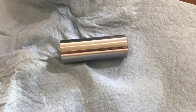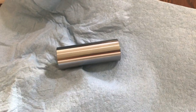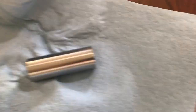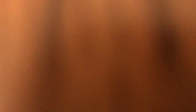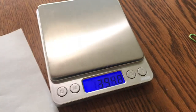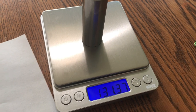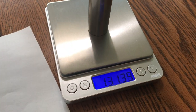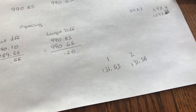Any little bit of grease or oil left on this is going to cause an unbalanced reading or a misreading, so you want to make sure to get every little bit of oil you can off it — that means even on the inside. Now that it's all clean, we'll take it over to the scale. Put it in the center. 131.37 — 39 — 37. So we're going to say 131.37. We'll do it one more time: 131.38. Write that down. Two readings of 131.38. Perfect. Next one.